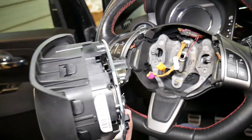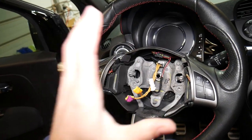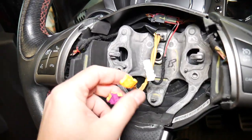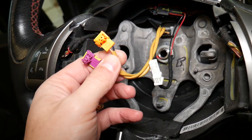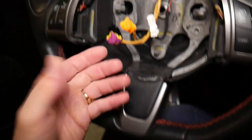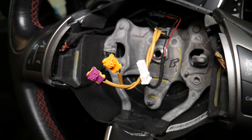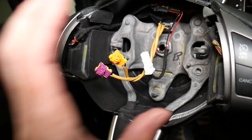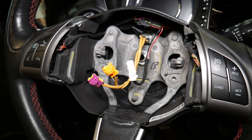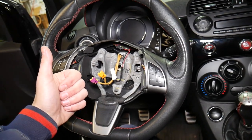The airbag is out. Installation is practically the reverse. Hopefully the video is helpful. Make sure the car battery is disconnected when you install the airbag. If you were in an accident, make sure the wires are not melted — when an airbag deploys it creates a lot of heat, so the wire ends can be melted. We have a video on rebuilding those, but we recommend just buying a new wiring harness. If you have any specific questions, let us know, and thank you for watching.